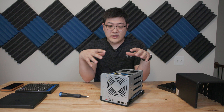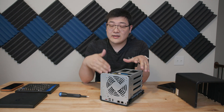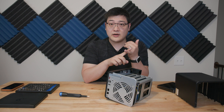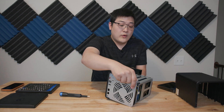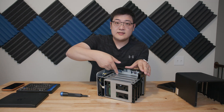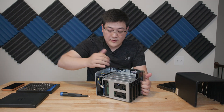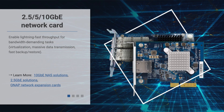If you're not very familiar with hardware and this looks like too much, just be aware that upgrading the RAM and M.2 SSDs is not very easily accessible. That's not to say it can't be done — just keep that in mind if you're planning on upgrading the memory or M.2 SSDs yourself. What is easily accessible just from taking off the case is the PCIe slot, which coincides with the expansion slot on the back. You can slide in either your M.2 add-in card or your 10 gigabit ethernet add-in card right there.